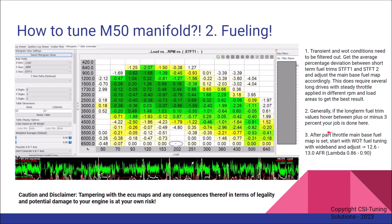For wide open throttle tuning, you need a wideband sensor and do a wide open throttle run in a high gear — like third gear — from low speeds all the way to redline. This way you get good data filled into your map and have better tuning possibilities. Again, for best power you're looking somewhere between 12.6 and 13.0 AFR, or lambda 0.86 to 0.9. Once you've done these steps — part-throttle base fuel map and wide open throttle fueling — your job with the fueling tables is done, and you can move on to the next and final step: the ignition spark advance table, where the most potential gain in power lies.